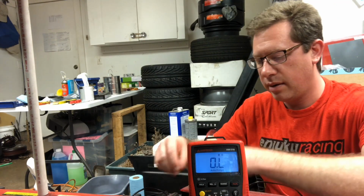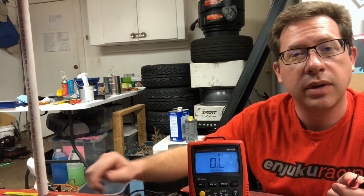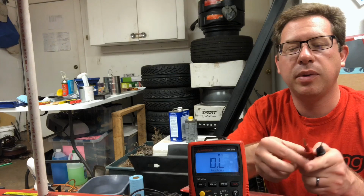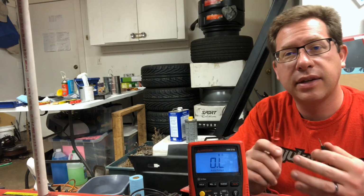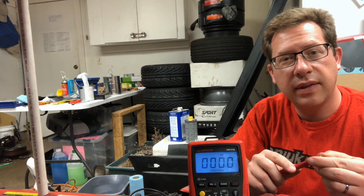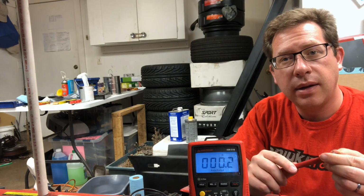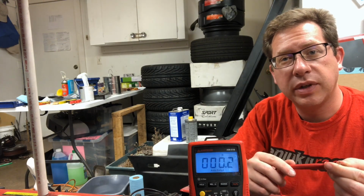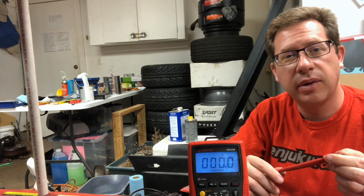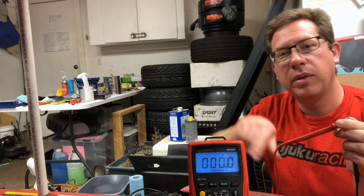It's not too bad. Alright, so it's starting with M ohms, and it's reading OL for overload. This is a self-adjusting unit, so as you put the contacts together, it'll actually adjust to whatever it needs to. When we touch these together, we'll see that it starts range finding, and it's going to drop down from M to K to just plain old ohms, which is a low amount, and we are seeing this low number because there is continuity. Electrical current can flow through this.